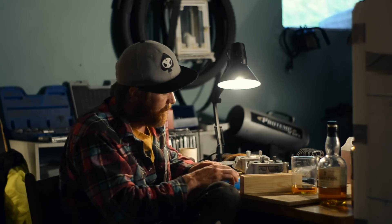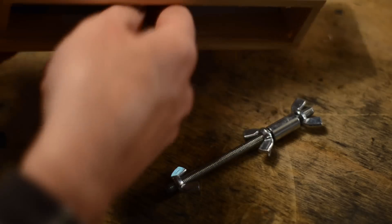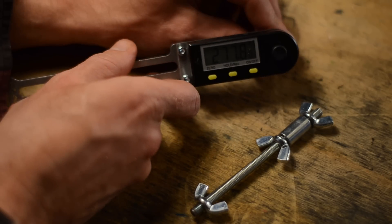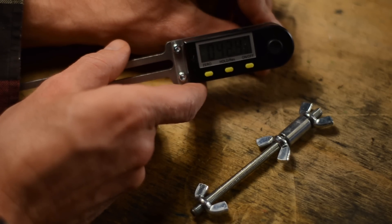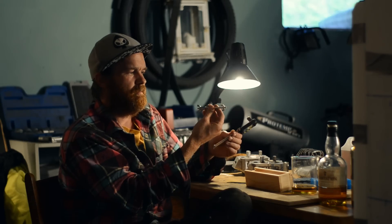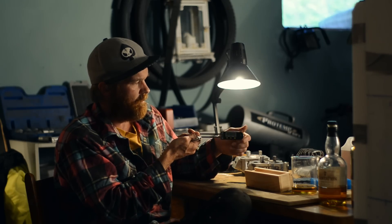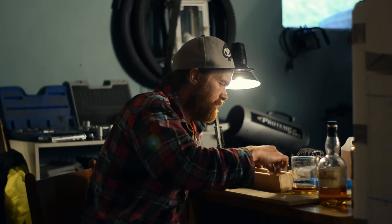You can check out DN Performance's videos — there are links to the site and the videos in the description. The next tool is a neat timing tool in a nice wooden box. It's a rotational indicator. There's an attachment for sockets, so you can attach the socket that fits the nut on your flywheel. There's also a bolt you can thread into an existing case bolt hole and fasten it that way. As you rotate the crank, you can read out the rotation in degrees on the display. Really nice — I'll use this tool in upcoming videos too.